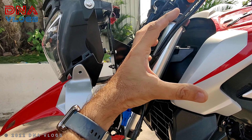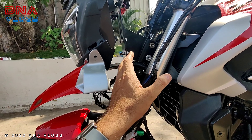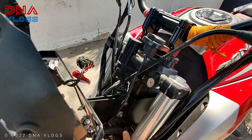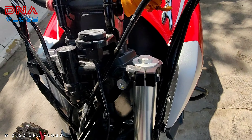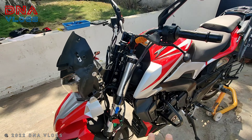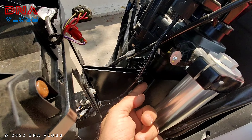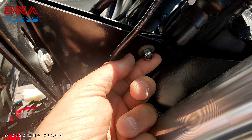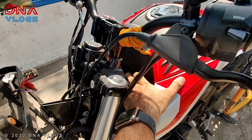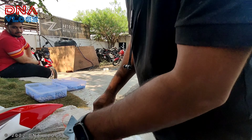Your headlight should be at bare minimum — just the headlight visible in the back cover. The stock back cover, lower headlight bracket, and top tank cover are not going to be installed because these will be replaced by new stuff from Autolog. The indicators will be installed again on the new covers. The number plate will go back. This is the complete kit, and Irfan is installing the brackets right now.